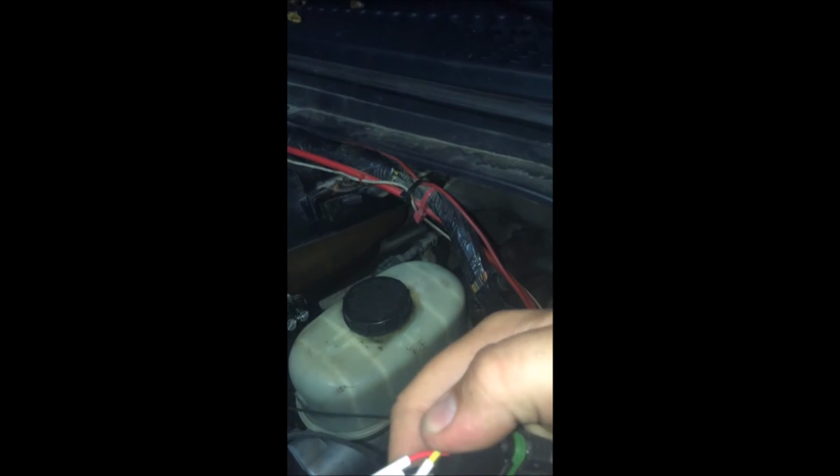So then we just need to plug this cord into the sensor body, if I can get that on camera. Plug that in there. And then you kind of want to route your wires. I'm going to route my wires up and over. I'm going to follow this wire loom here to the corner of my truck where I've got the Edge system, and this is the B side of the universal input. Go ahead and plug that in.